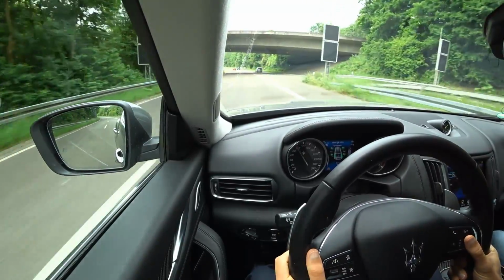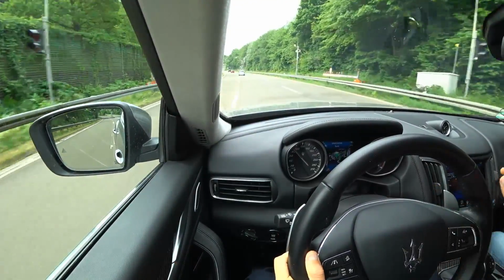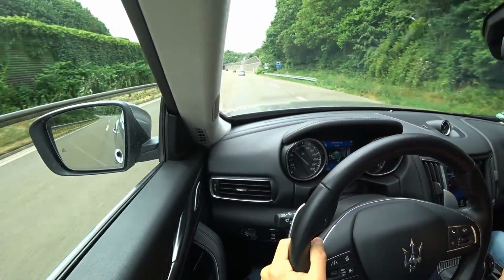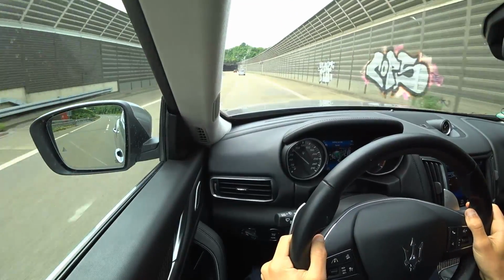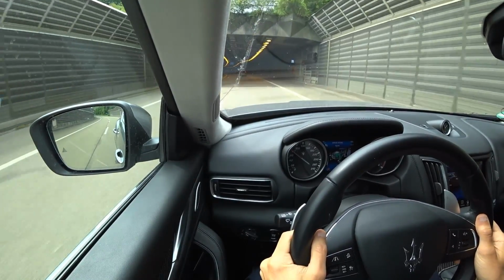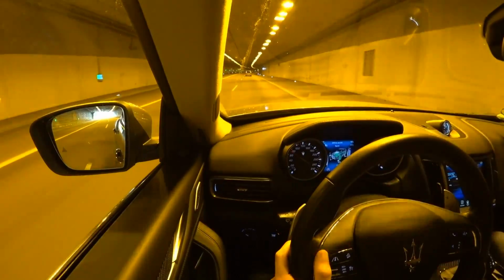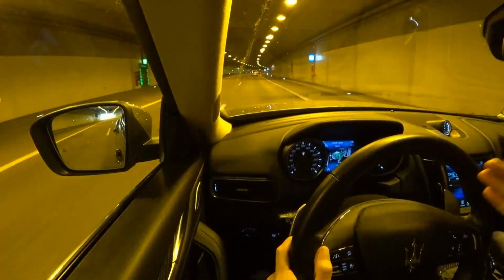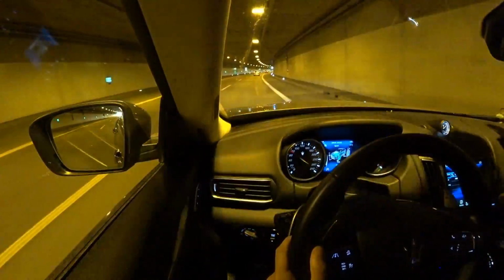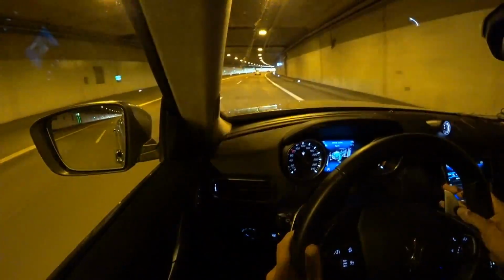And let's see, tire pressure information, because there's also this information mode where you have the axles, and you see that in the normal mode, when I'm just letting the car roll, throttle a little bit, it's 100% from the rear axle. You can even better see that probably in a display when I'm in a tunnel. But as soon as I apply the throttle a little bit harder, then more power comes to the front wheels. For example, when I press like this, you can't see my foot, we don't have a foot camera mounted there. Now, for example, it's 75% rear, 25% in the front. So two-thirds, one-third, something like that.